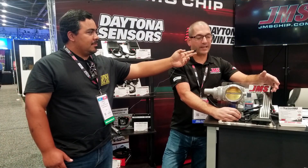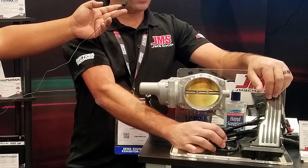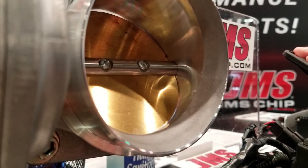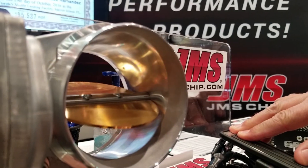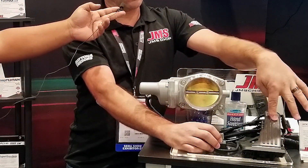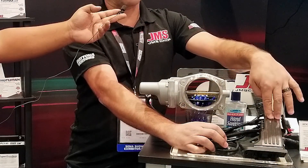This particular product is our TractionMax. For anything that would have like 1,000-wheel horsepower — these factory supercharged cars have a lot of power and a lot of torque, so instant throttle would spin the tires. With this device, you can control the rate of throttle opening no matter what the pedal does. It also has a lockout feature for a stick vehicle: as soon as it goes wide-open throttle, it turns on a lock feature where the throttle, for the next 20 seconds, performs like it should.